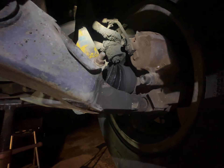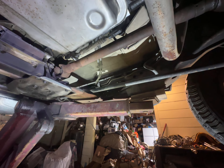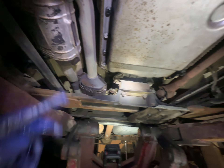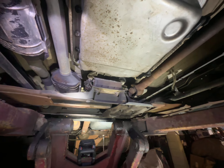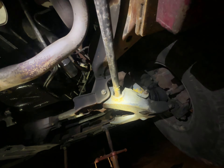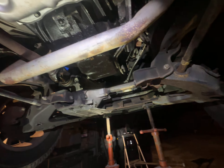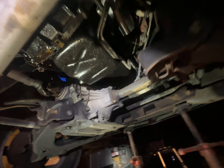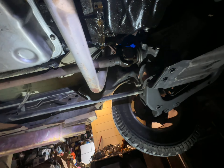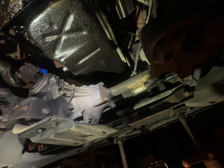There's a CV boot that's bad. The car has 200,000 miles. It does have a new aftermarket catalytic converter that meets California standards, and we put new O2 sensors in there. This car originally had a bad distributor throwing a bunch of random misfire codes — it turned out just one of the bolts came off the distributor. If you have that problem on this car, check that first.